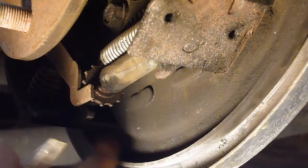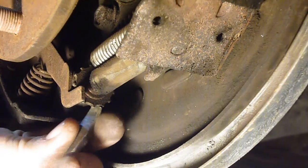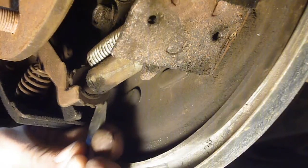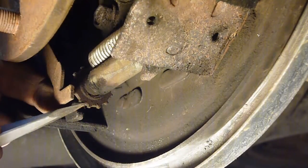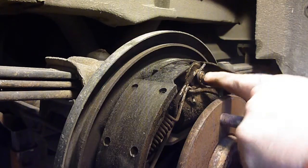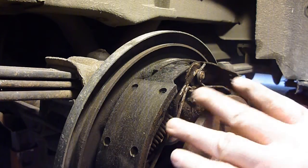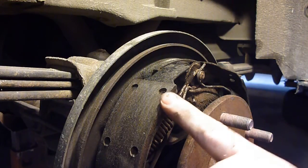There's nothing you can't do with a screwdriver and a pair of vise grips that this kit can do. With this tool you'd come in from behind the plate through a plug hole, and with a screwdriver you can adjust these tighter - it pushes out in this direction and tightens your brakes up. What I want to do is actually loosen these brakes up. I went to look at the kit for the brakes - you used to pay half the price and get the brake shoes plus a whole set of springs. They'd take the old shoes back to recycle. Nowadays they don't even want them back, so they don't recycle anymore. And you don't get springs.